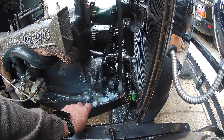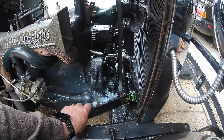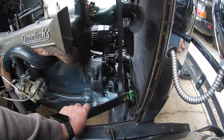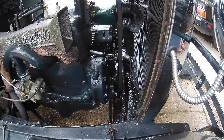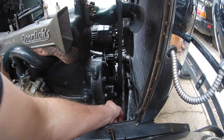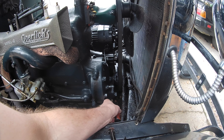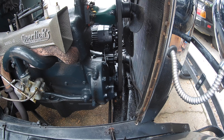If the coils are all bound, that would remove the springiness from them. It almost makes me wonder if there is a nut or bolt down there — if you loosen that, would it allow the springs to come up a little bit, or are the springs just worn out and collapsed? There's no room there. It's sitting flat on each other, so it's basically a solid motor mount right now. That explains the vibration right there.